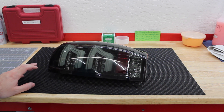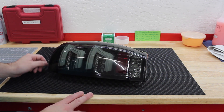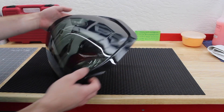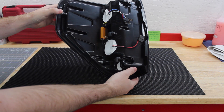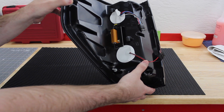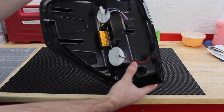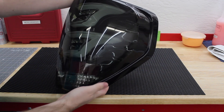At first glance it all looks really nice. I'm not a big fan of aftermarket tail lights normally, but there's really no good-looking LED option out there for the first-gen Raptors, so this was the best I could find as of early 2022. They seem to be pretty decent build quality. My truck's a black truck so I went with the smoked look. On the back side we've got some stickers for where the LEDs plug into bulb sockets. We have a built-in load resistor, so we don't have to worry about wiring any of that in ourselves for the turn signals. There's also a little drain tube, and overall construction, fit and finish looks pretty darn good.